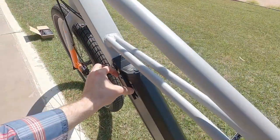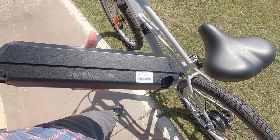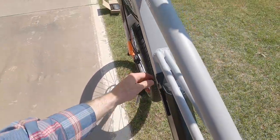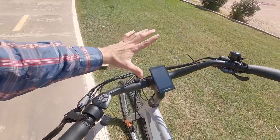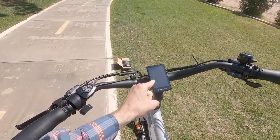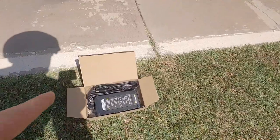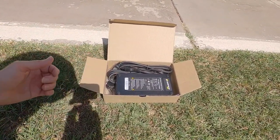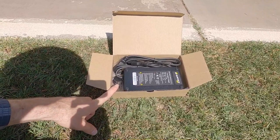Insert the key to remove the battery — the re-engineered Dorado battery pack tips out. It's about 6.5–7 pounds, 48 volts, 12 amp hours. There's a USB charging port on the battery itself, which is cool. There's also a second USB charging port right at the base of the display — great for powering an aftermarket light or charging your smartphone for GPS. The display is color and really nice. The included charger is a 2-amp charger; faster 4-amp chargers are available, but for the base 500 Wh pack this is fine. If you get the higher-capacity optional batteries, you can get a faster charger from Surface 604.